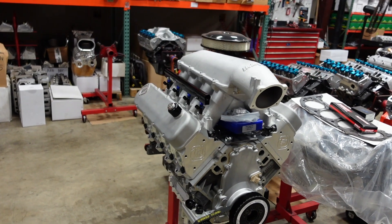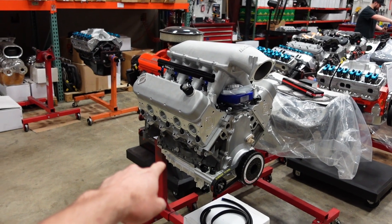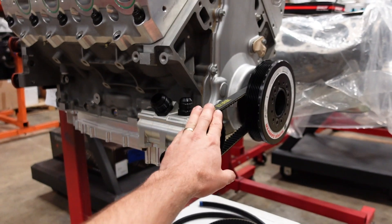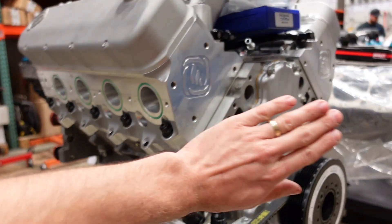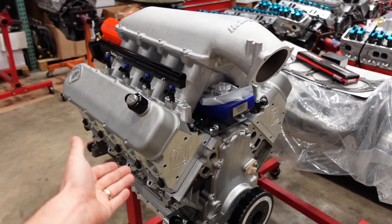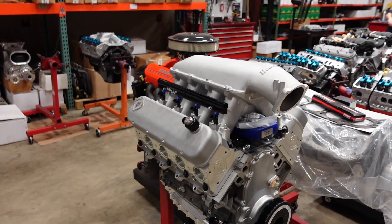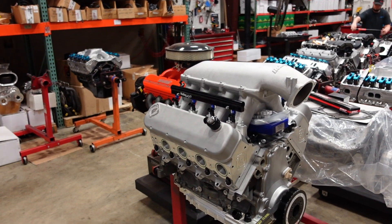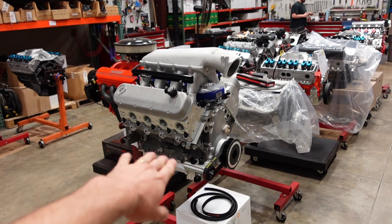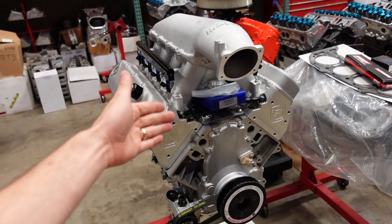This is probably the rowdiest 416 that we've put together. It's a new 6.2 aluminum block. We're running that same daily dry sump 3 stage system — I actually have this on my own car as well, it's really nice. He's running a small bore LS7 cylinder head. It is 13-to-1 compression. This guy should make, we're hoping, 730-ish horsepower at the crank, and it is set up to run a 300 shot. And of all things, he's putting it into an RX-7. So a 1,000 horsepower capable nitrous deal in an LS in an RX-7 — that's going to be really cool.